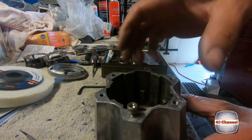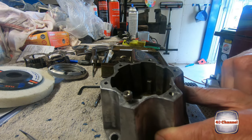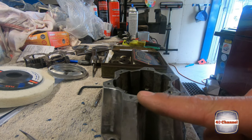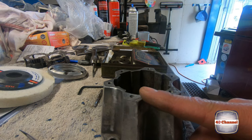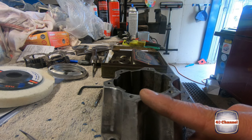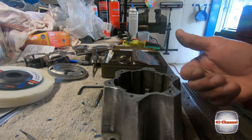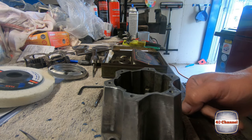That's fantastic. That screws in pretty tight. Righto, so we ended up repairing this hole with a bit of epoxy putty. Came up pretty good. Now I would totally recommend, if you had the opportunity to use a helicoil set, use it. But I had to improvise, and it's going to work pretty well.